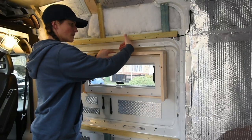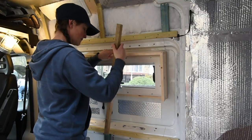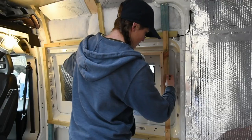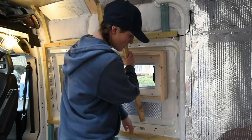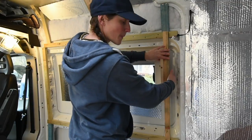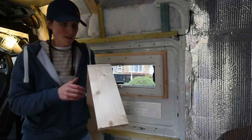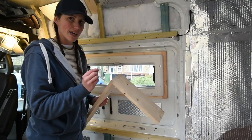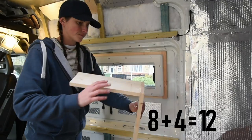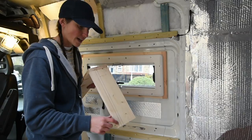Because it's not going to run - I don't want it sticking out too far because my cladding up here is going to sit quite far back. Obviously when I get to the bottom the gap is wider, so I'm going to cut them at the angle of the van and follow them down. I've run a straight edge because my cladding is going to run on these uprights. I draw a line down the back of it and that gives me the back edge of my cladding. My cladding is eight mil, so I add on eight mil, then another four mil overhang - so I've measured 12 mil from the back of my cladding out and that's where I'll cut at that angle.